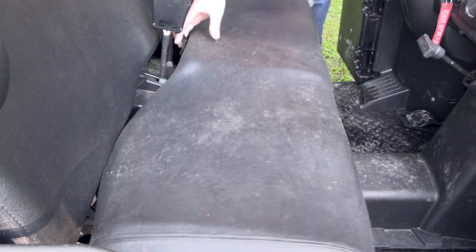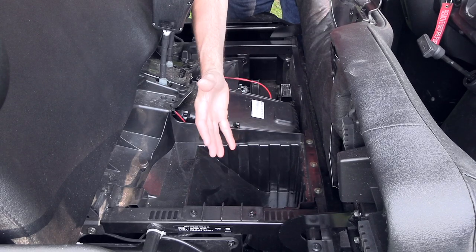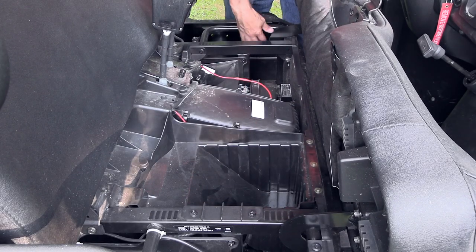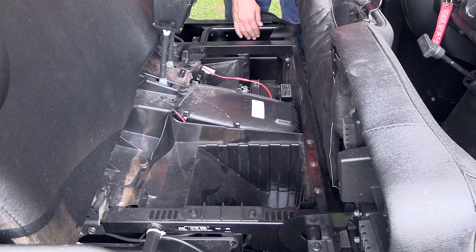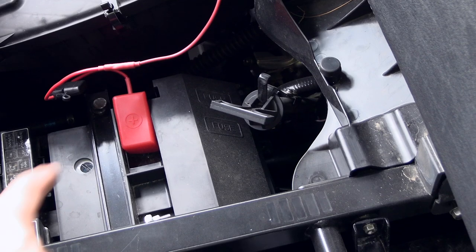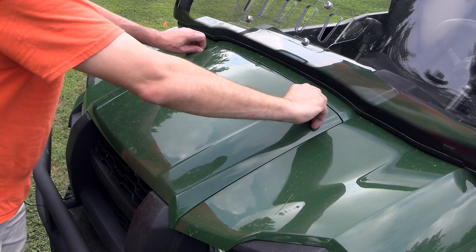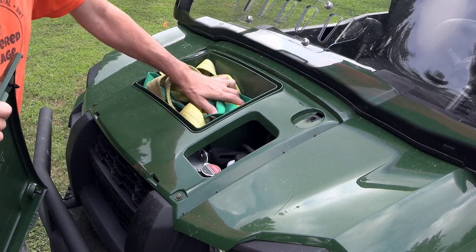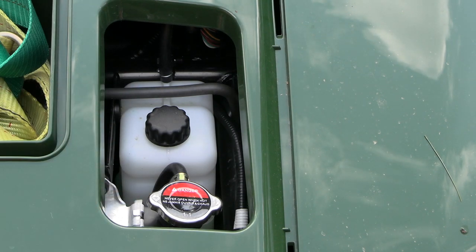Pardon the dog — she loves it up here. There's a single latch for the seat; it tilts forward and there's a small bin where you could put a tow strap or something. It's not weatherproof but it is at least a small storage area. On each side of the seat there are openings — not really made for storage but you could fit a bag in there. Under the driver's seat is easy access to the battery and you check the oil right there. There's also under-the-hood storage: slide the hood off and there's a little bin where I keep my tow straps, plus easy access to the radiator and antifreeze fill bottle.